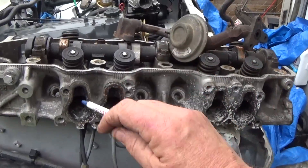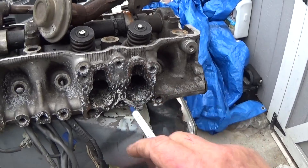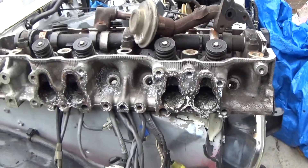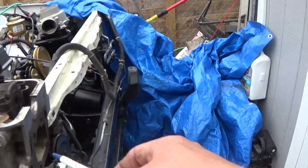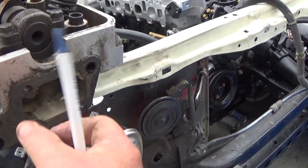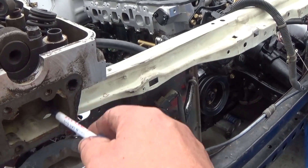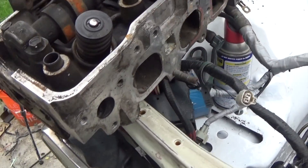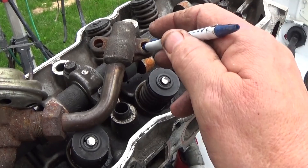All right, so this is the old head. Looking at your air injection, it's going to go in here into your exhaust — those four ports — that's your injection of fresh air going down through there. As far as your EGR, that's going to be internal. Your EGR is actually part of the chambers of the head. Coolant goes through here, the EGR gases go through that cover plate across, cool off because of the coolant here, and then come back out through the EGR. As it goes through the EGR on and off, it'll come up through here and go back into your intake.